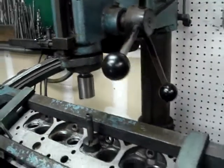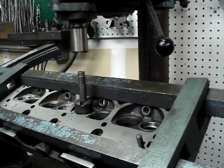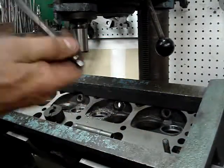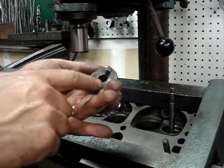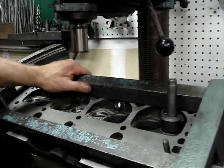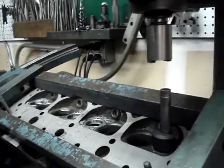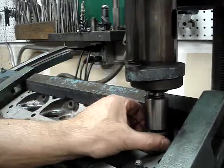So what I did is I have another cutter that we've gone in here with, and you can see we've cut the tops of these seats down so that they are flush or actually a little below the surface of the head. I'm going to go ahead and continue to cut this last one here so you can get an idea of what's going on. We'll move the table here — this is our pilot. This pilot is going to go down into our valve guide, and that's what guides us in. We have a sleeve and then we have our cutting tool — these are carbide cutters. Our sleeve is going to center this on the pilot and then we're just going to bring this right over to the cutting head.